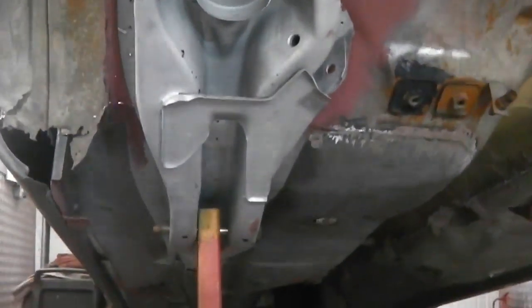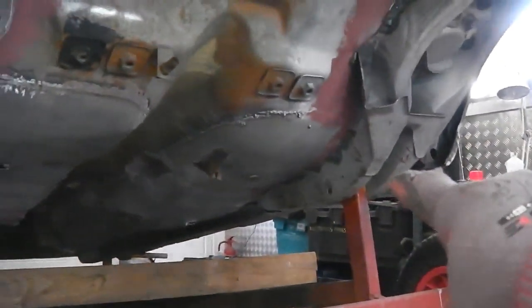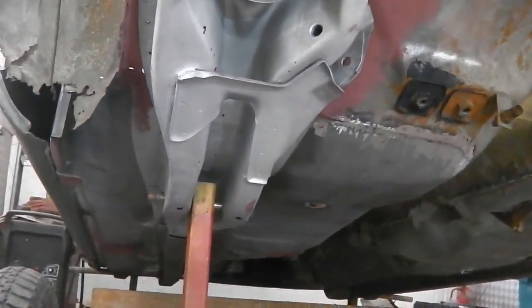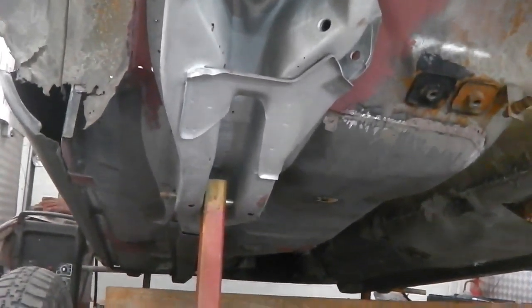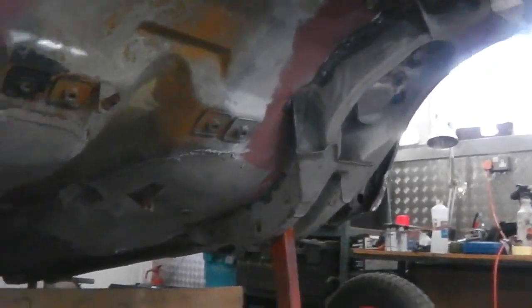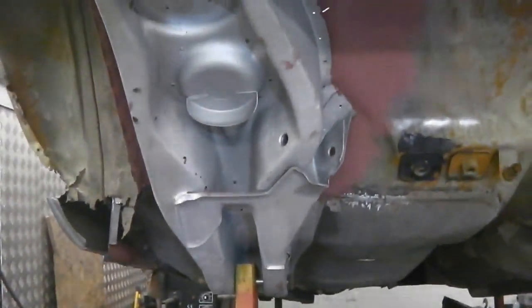We do that now by measuring. Take the measure at the ready, and then just make sure the points between the two legs here, from there to the other leg, and from that point to that other point, is a square. If it's all square, then we're good to go. So we're looking for a square there. Okay, I've got the tape measure, and then we'll get some tech screws in, then we start getting some plug welds in. So pretty much the same as when we did that side, really. I'll probably not show you the welding procedure on this. You can see the welds on that side, now we've lifted it up, they've penetrated through, so we know we're good. All right, so a little bit of welding and tech screwing for me and a bit of measuring. We'll see how we get on in a minute.